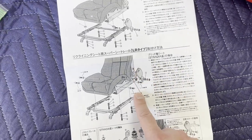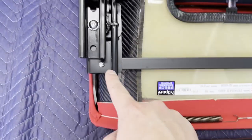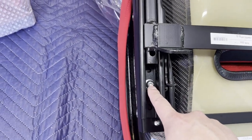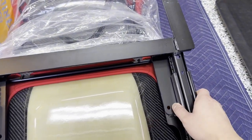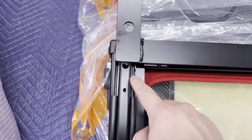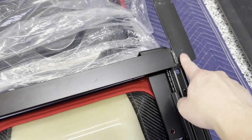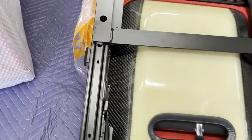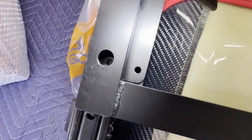To mount these up, slide the rail so the front of the seat doesn't block the hole. Mount the front two bolts loosely first to keep some left-right and up-down play, then slide the rail downward and insert the bolt through one of the holes in the side. Once you slide the rail down you can see through the hole that it lines up with the threaded portion of the seat rail on both sides.